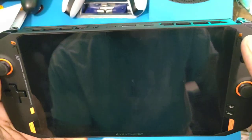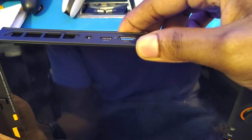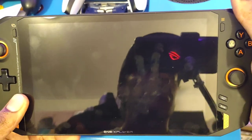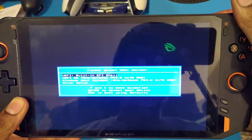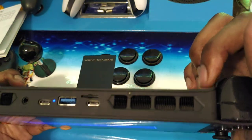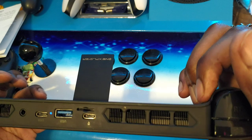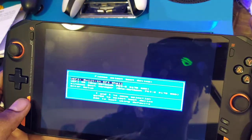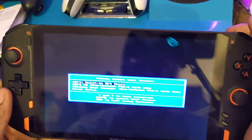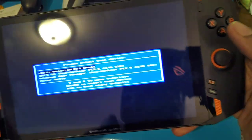Afterwards, remember you press and hold the power button for about a second until you hear the vibration, and then press volume up. You can press it a few times — just like FN and F1 where you just tap it multiple times. It's worked for me holding it, but it's worked more consistently by pressing up on the volume up key while holding this, which is FN. Then you activate the keyboard and mouse by holding the keyboard and mouse icon and it'll put you in keyboard and mouse mode with full control of the boot menu.